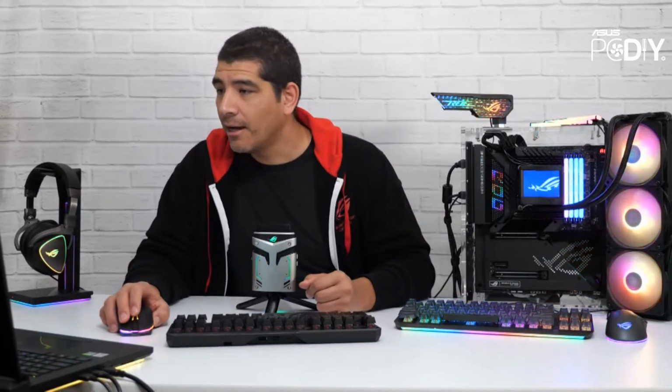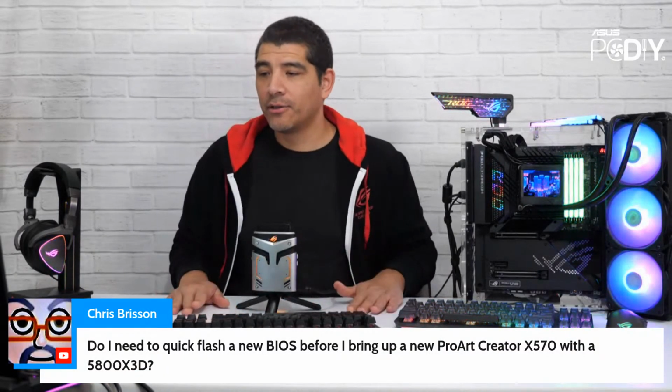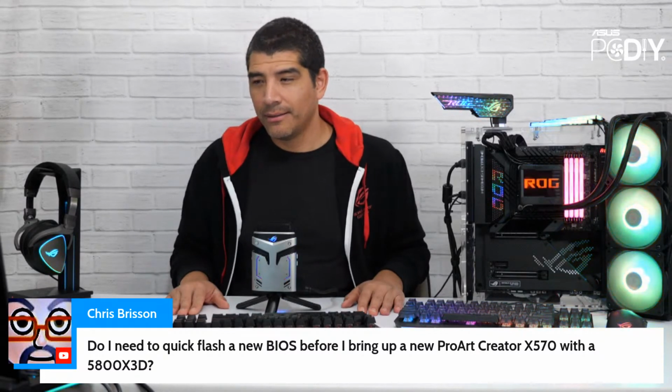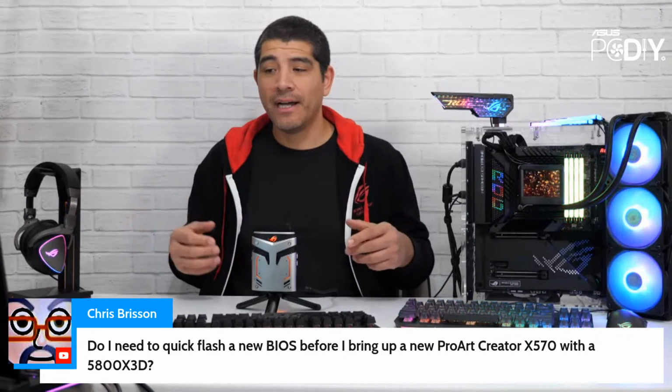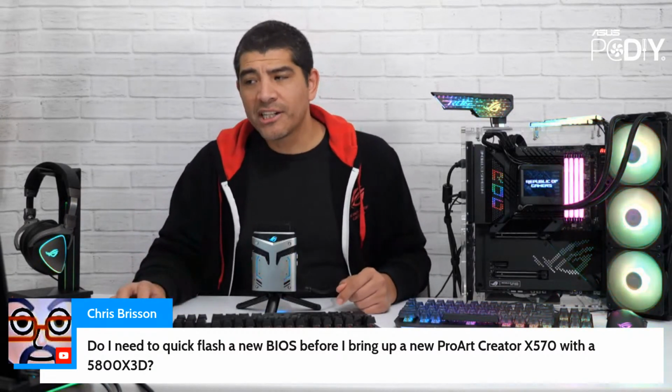Okay, all right. Chris is asking, do I need a quick flash BIOS before bringing it? Sorry, I think you're asking, do you need to update the UEFI to be able to support the 5800X3D on a ProArt Creator board? You should actually be okay. Pretty much any of the boards that have been in active production for some time should already have a baseline UEFI firmware that should allow you to just drop in the CPU and get up and running. That being noted, there are probably much newer UEFIs that help improve the overall interoperability, compatibility, and performance.